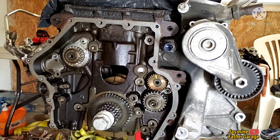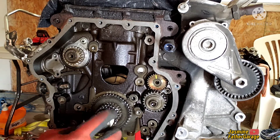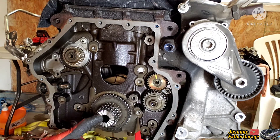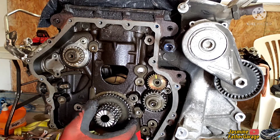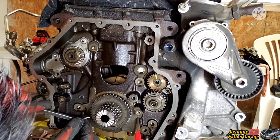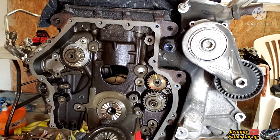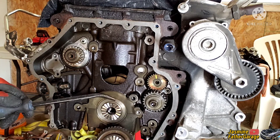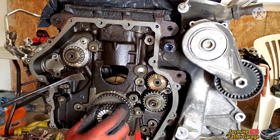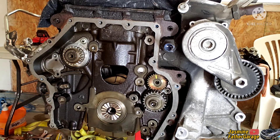Let's go to the crank. Take out the crank bolt. Here's a spacer that came with the kit — you need it so you won't damage the groove when prying. Put a little tiny reference mark right here on the old sprocket. See that flat spot right there? It's magnetic. We're gonna trash this one and put a new one in.